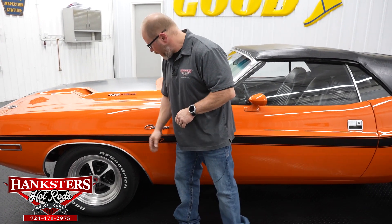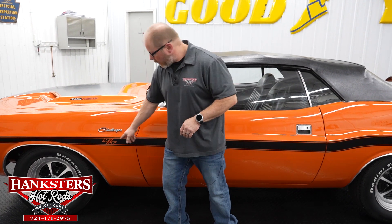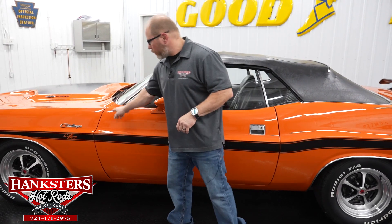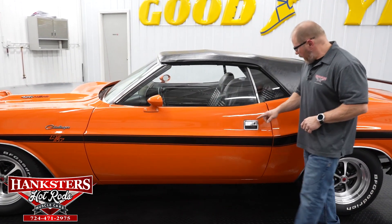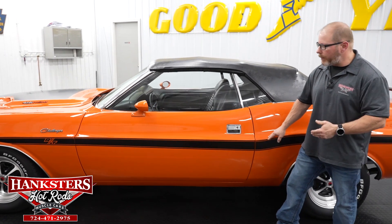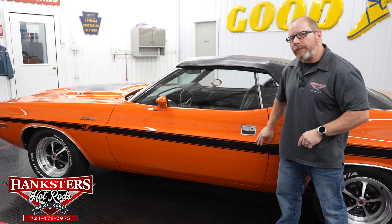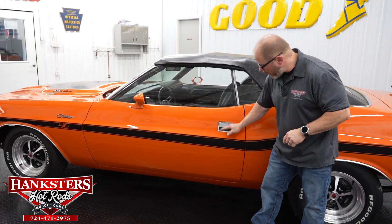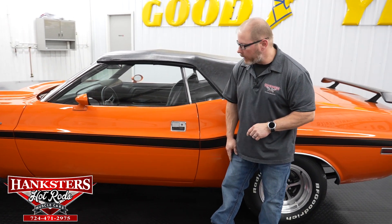The wheels and tires are in great shape on this vehicle. We've got the Challenger badges here on the front fenders along with that RT striping. As far as the doors go, we always check our door gaps here to the front as well as to the backside — very, very uniform front to back on this car. Elevations with the quarters and the fenders are all right on, and all of your body lines line up with one another.